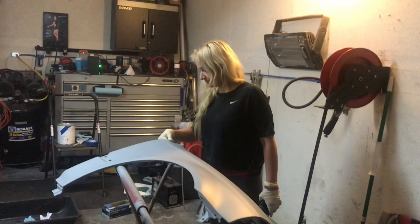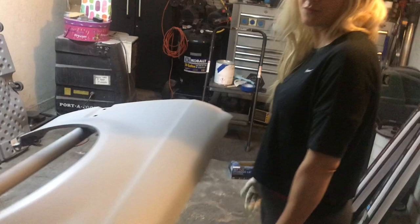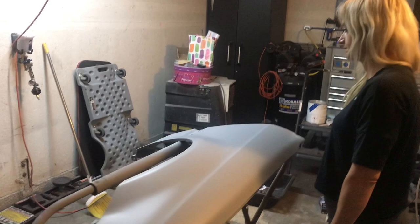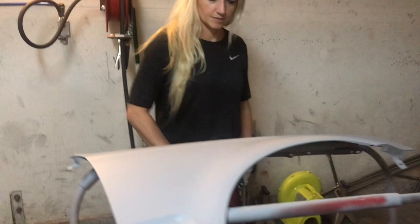Okay. So do you have any tips for people that are spraying in a garage? What are some of your tips or advice? Blow everything out and wet everything. The walls, the floor, everything. Cover it, you know, overspray. And how do you fight trash? Just by cleaning it? Water. A lot of water. Water on the floor. And the walls. Good ventilation? Well, yeah, that always helps, but sometimes you don't have that. Okay. Any other advice you have for maybe beginners painting in a garage?